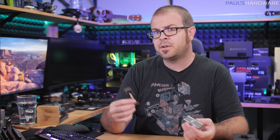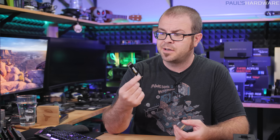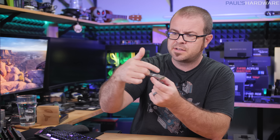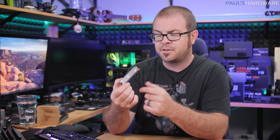But what if you don't want your fancy NVMe SSD to slow itself down? Then you want to keep it a little bit cooler. There are a few different ways to do that. One is to make sure that you have airflow going over it, but that's not always an option. Another solution is to have a heat sink on it. There are a lot of different heat sinks — some that come with the SSD itself, some that are aftermarket that you can buy and add on if you have a standard M.2 2280 SSD.